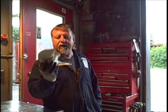But I'll give you a shot of it running here. I took the propeller off. It's all bent up and leafed over and everything. And I'll show you the needles here. What this engine needs now is to mix it about 24-1, and then I need to take it out and run it wide open throttle, and get a good tank or two of gas through it and see what it's going to do. To me, I hear a little bearing chatter or something going on, but overall not bad.